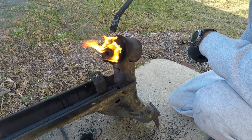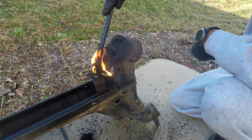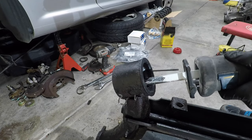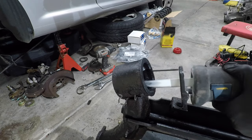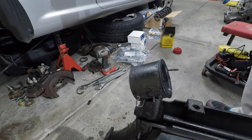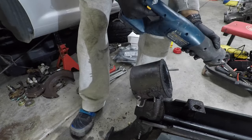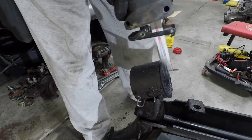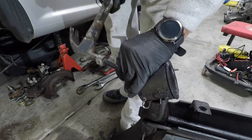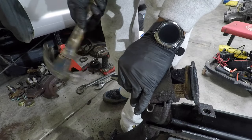There she is. Now I need to remove the two layers of metal sleeve that were the outer portion of the old bushing. I used my reciprocating saw with a metal cutting blade to cut slots in them so they would be easier to free from the bushing housing. I then separated the sleeves from the housing using a combination of chisels and a hammer.